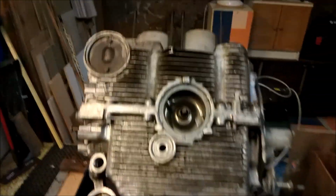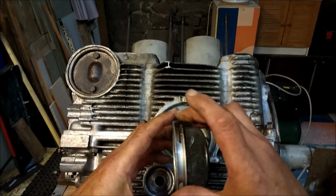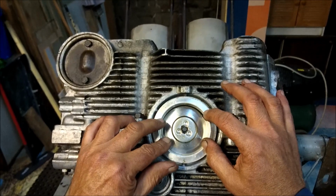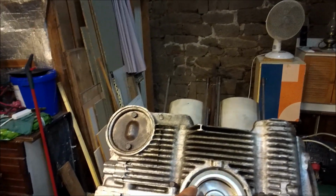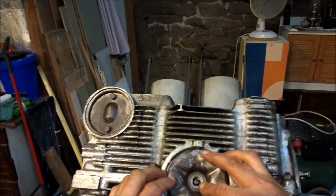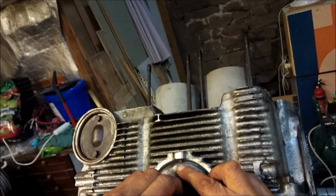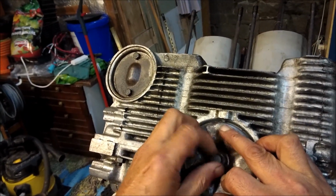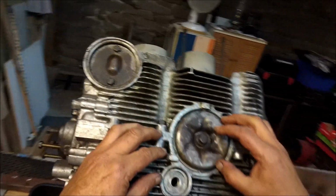Now then, oil strainer. It wants to be pulled out into shape and looking nice, and not dinted and damaged. Everything has been cleaned down nicely. See? That's fine. And then we have the next paper gasket. Now look, you see there's locating lugs all the way around to make life that much easier. Okay, goes out this side. And you make sure everything is all nicely lined up. Just loosely on, don't force anything, and then you float everything into place. Look, that's starting to look quite nice.